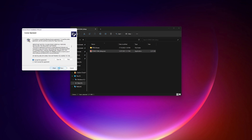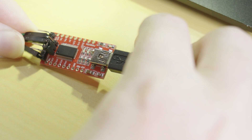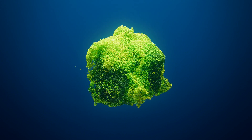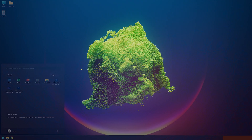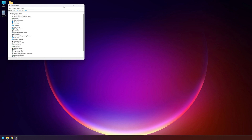Just follow the prompts in the driver installer to complete the installation process. Now, with the drivers installed, connect the USB adapter to the computer. For this next step, we need to find out the COM port number of the USB UART adapter. To do this on Windows Vista and newer, simply type device manager into the start menu search and click the icon for the device manager.